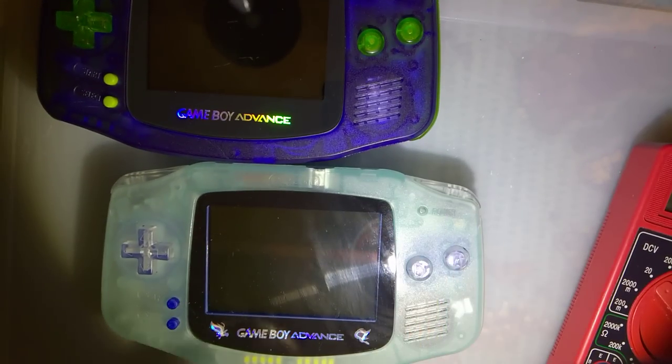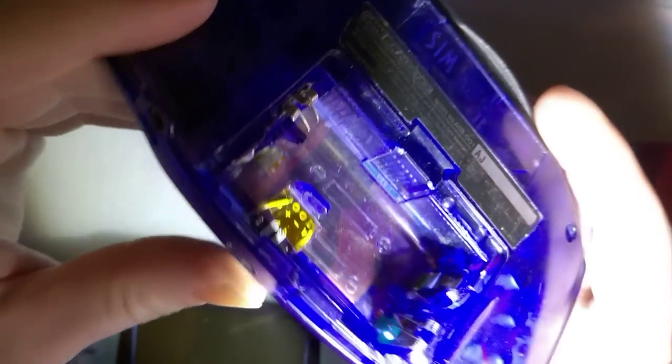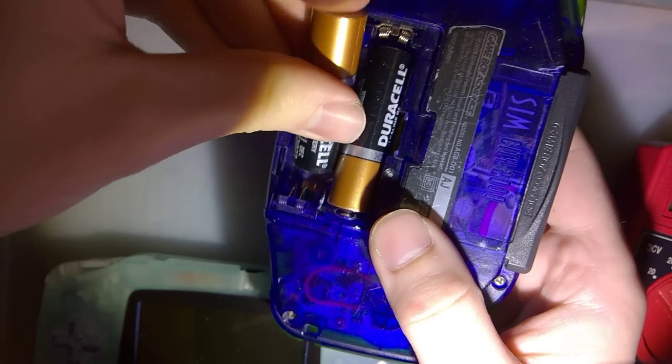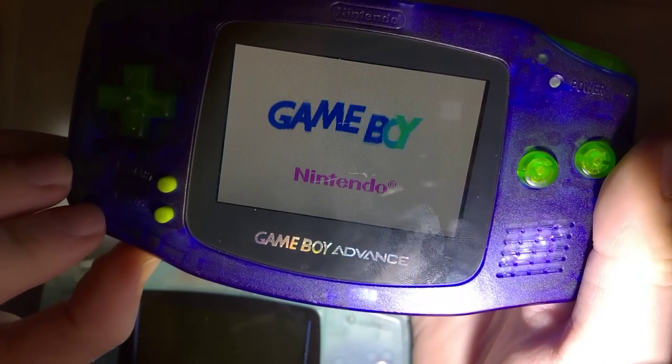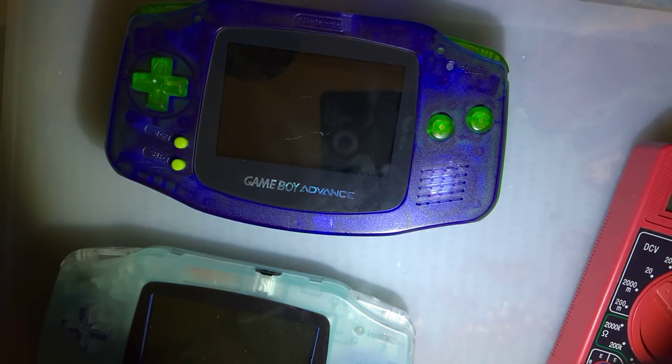Compared to my lithium-ion battery mod, I'd say this is much more functional because I can just pop out the batteries. Ignoring this cutout — which by the way is not interfering with how the batteries fit, it's lower than the plastic — you can pop in regular alkaline batteries and everything still works as normal. Just don't try and charge those. There's your nickel metal hydride battery mod. If you all have any questions, feel free to hit me up in the comments. But again, I really do not recommend doing battery mods unless you know exactly what you're doing. Do your research first. Don't just do it and accidentally blow yourself up. But on that note, thanks for watching. Have an excellent evening.